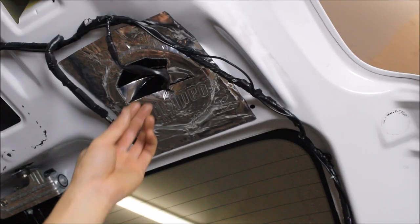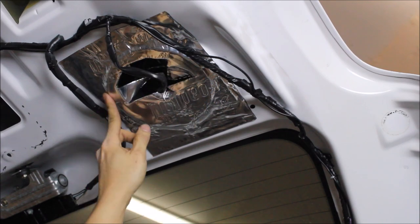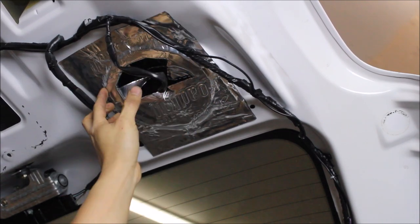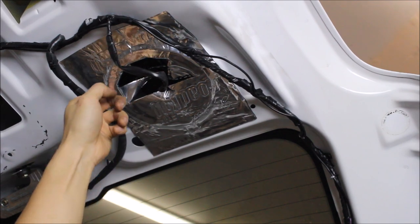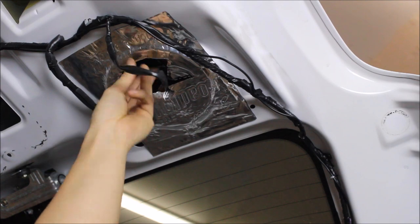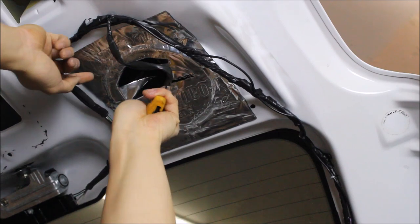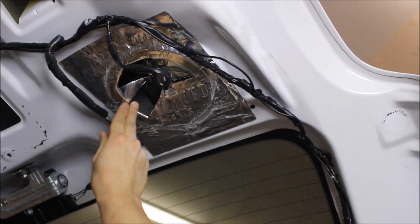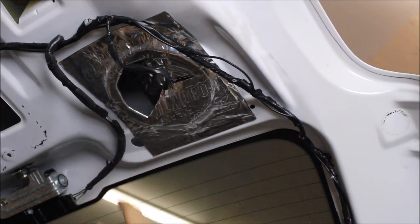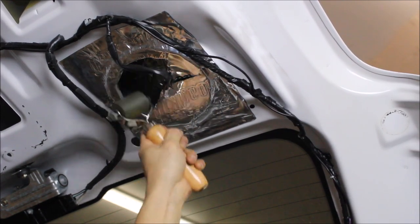We now have our sound deadening over the speaker adapter. The reason we picked sound deadening over the speaker adapter in this case is because when I clicked it in, even with the screws it still loosens the gap quite a bit. This allows us to seal the gap and also help hold the speaker adapter in place, helping increase sound quality because it is not going to move around. We also made some pie cuts and are folding the material back, doubling up the amount of material. Then we are going to work it out as much as we can to maximize the diameter of the opening.